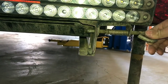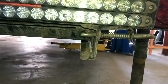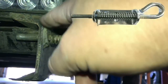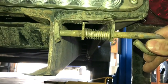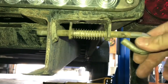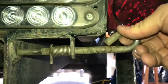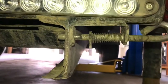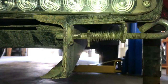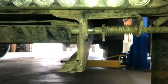Lately I've been having some issues with these little pins that hold the ramps into the back of my car hauler. These little pins are pretty common — they come with a little bit of C-channel. You pull it back and lock that little roll pin up into that slot. Sometimes it works, sometimes it doesn't. You can kind of flip them up and hold them open, but the problem is they're so thin that the pin ends up bending and breaking, and it was a ramp going down the road.